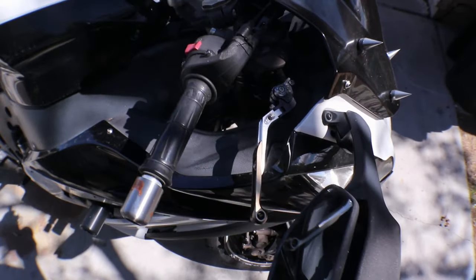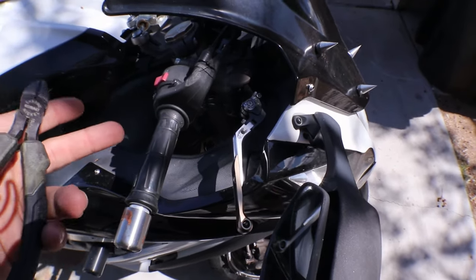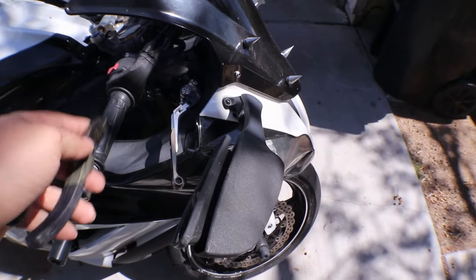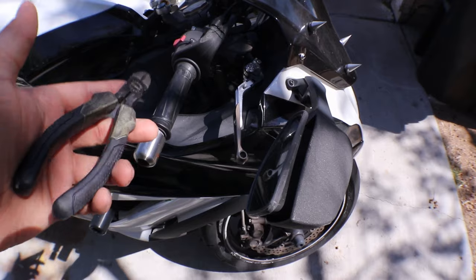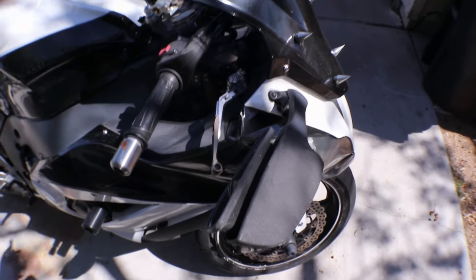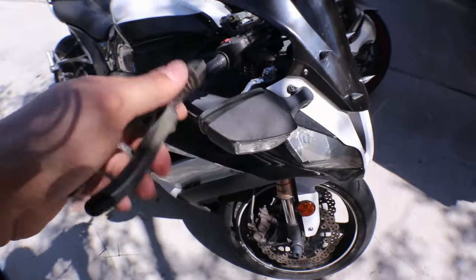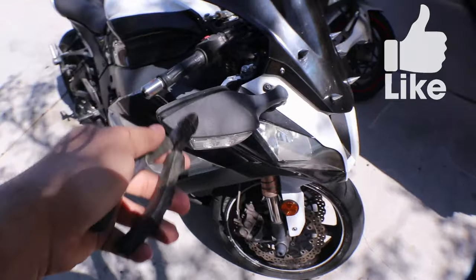After it's been sitting, take your snips, cut the zip tie off, give it a couple of pumps, and you should notice a little better brake pressure. This is a really nice trick for people trying to bleed their brakes when they just can't get it rock solid like it was from the factory. I hope this helped, and I'll see you in my future videos — don't forget to subscribe and give this a thumbs up!